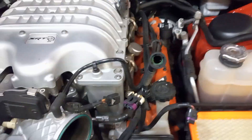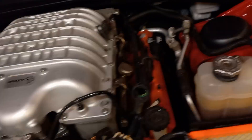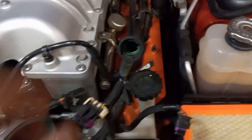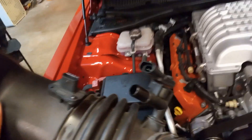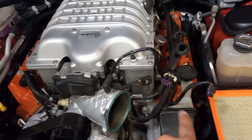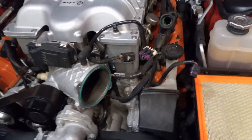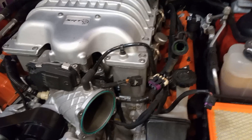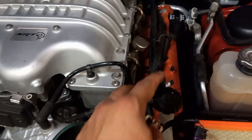You may notice a little bit of oil residue on that portion of the circuit — that's not unexpected since this thing is attached to a valve cover. That is the draw side, drawing from your boot right here. You'll see a little bit of oil residue there. Now under boost, both sides are going to be venting into your snout and into the portion of your supercharger which is drawing air — so under boost both sides are acting as crankcase ventilation.